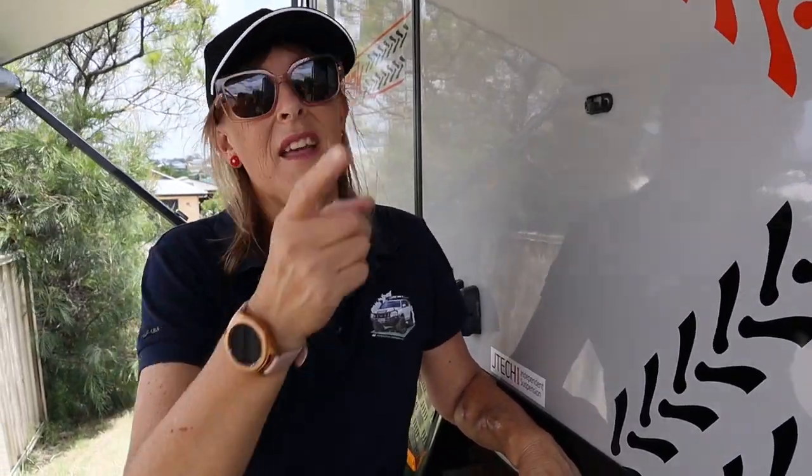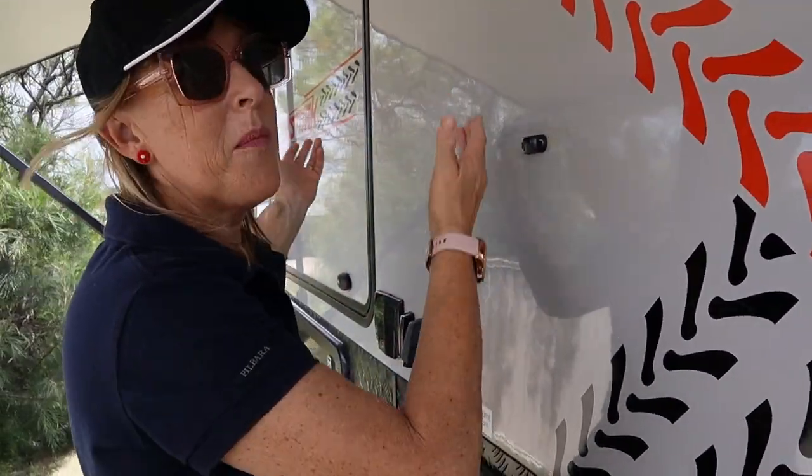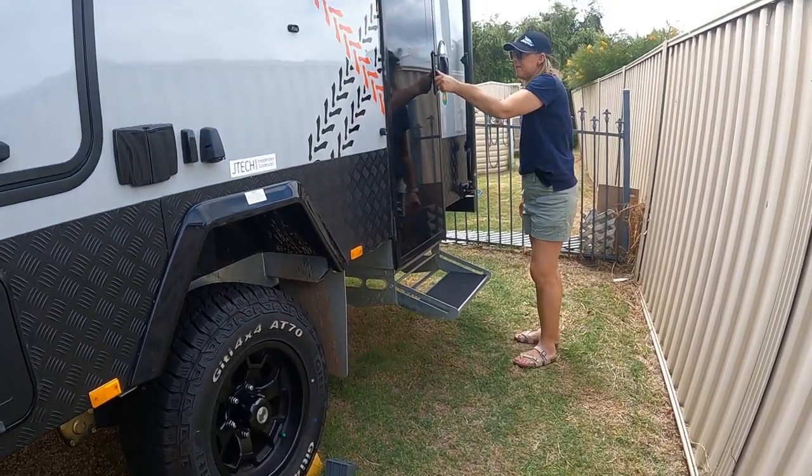So I just opened the door enough to sneak in. It's good to leave the door open a little bit because when you're pushing the roof up you're creating a vacuum, and it's much easier if a door is open. The sequence Jayco told us is: door end first - put that end up first, then hop on the bed and push the other end up.